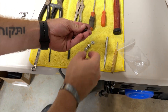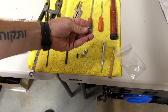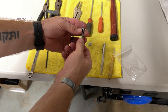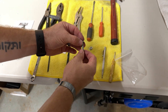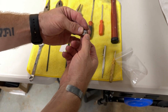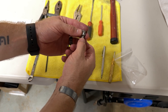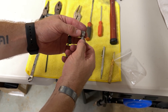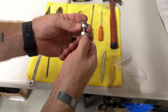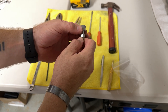This is the new set screw with the nylon thread locker, a pair of washers to swap out the tooth washers, and this is a bolt we're adding to brace the bracket to give it a little bit less flex. This is the chain tensioner. We were going to make some type of spacer but we realized pretty quickly with the chain stretch and the variability in different setups it would be impossible to make a one-size-fits-all spacer, so we're going to give you something adjustable that you can adjust to your needs over time depending on chain stretch and your specific setup.